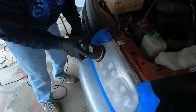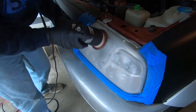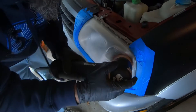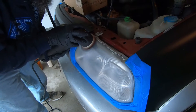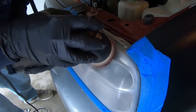Then we're gonna bust out the compound — this is Meguiar's 105 on a microfiber pad using the Rupes mini machine. You'll see me going fast at first; that's just spreading the product out. Once you get to the actual compounding you move the machine relatively slow and let the compound do the work.